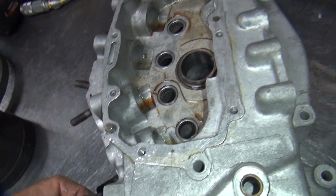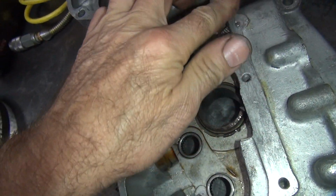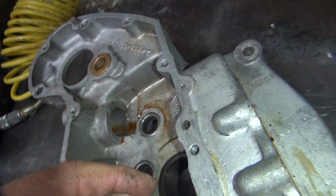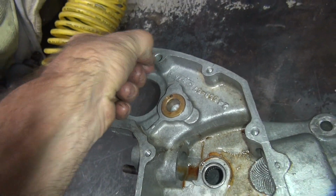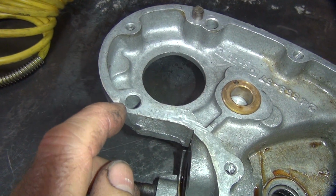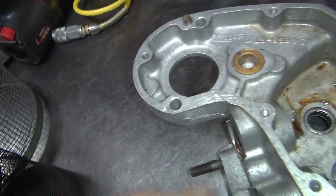So, also while you're cleaning stuff, you're looking at things, just like I was looking at that. You want to make sure things are not sticking above the surface where they can cause a problem with the cover going down. You can see how there's a whole bunch of scratches and stuff across these surfaces. You're looking for gouges, cracks, breaks. Someone got a little carried away with their chisel right here for some reason. That's not the best of conditions.